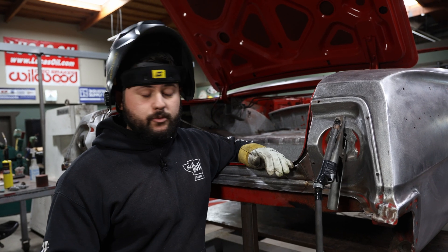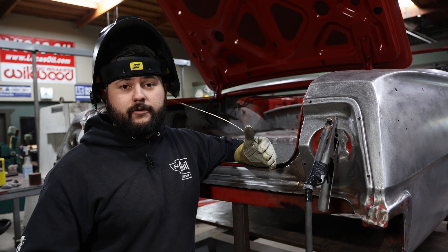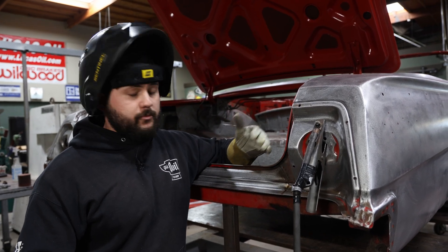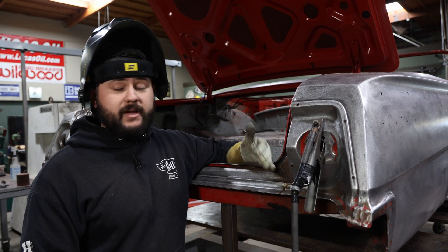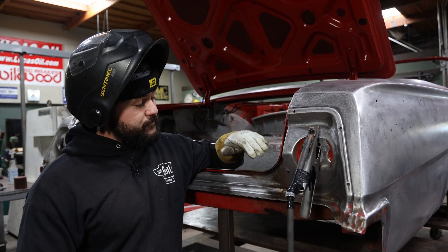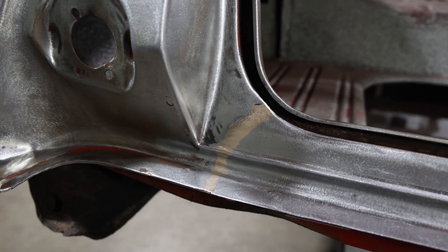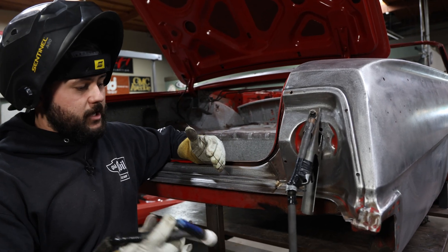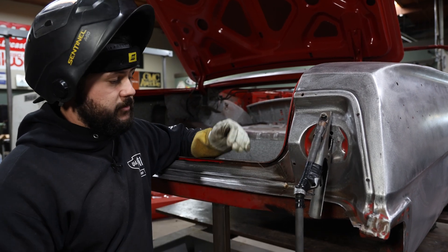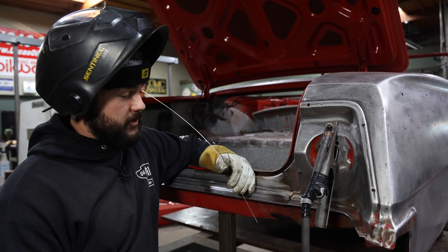So on a factory seam like this that we're planning on filling, it's considered a stress point. So if you fill it with your standard body filler or your standard welding rod, which is like ER70S-2, once that's all filled up, over time after your paint work's done, there's a good chance down the road that that's going to end up cracking. So we like to use silicon bronze filler. It's great — it's nice and soft, so once you fill up your seam it's really easy to work and smooth back out. Plus over time you're not going to run that risk of it cracking. It's just like TIG welding, only as you're welding it's a lot more liquidy, so you just kind of add into that puddle and let it wet out and fill up. A lot of times I'll make a couple passes over it if I'm trying to fill a deeper joint, and you just get after it.